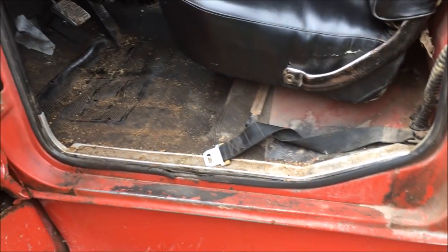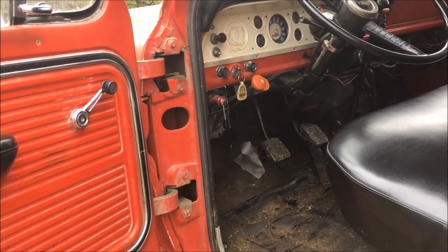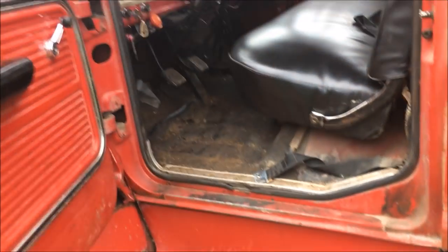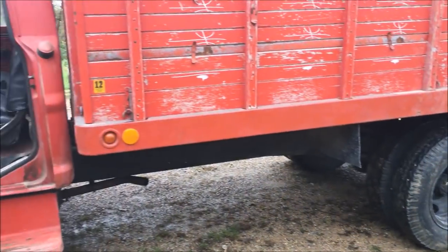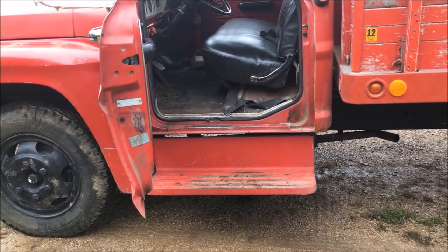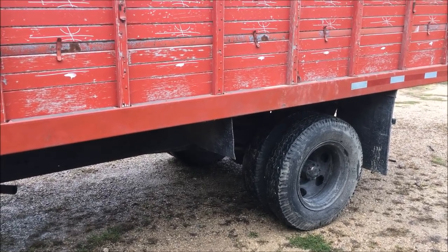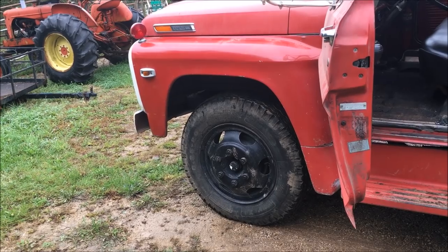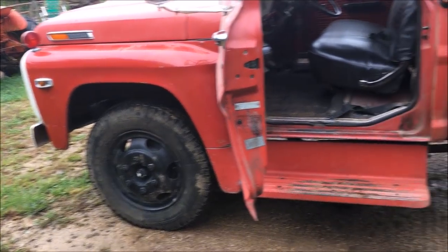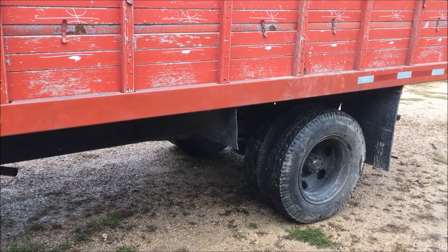What I'm going to do with this: the brakes work really well, but the master cylinder leaks a little bit of fluid down into the floorboard, so I'm going to put a new master cylinder on this. All of the steel brake lines appear to have been replaced fairly recently except for the one from the master cylinder down to the booster cylinder, and I'm going to replace that one. I'm also going to replace the rubber brake hoses — the one that goes from the frame to the rear end and the two that go from the frame to each front wheel. They look to be the original ones, and if that's the case they're 50 years old and need to be replaced.